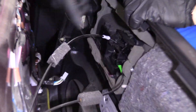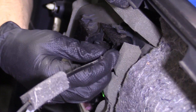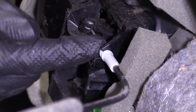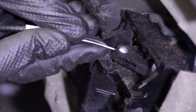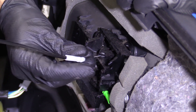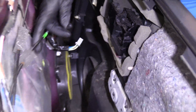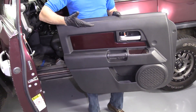Behind here we have our cables. This one's the door lock up along the top. All you do is take the white — you pry it away, then you lift right up through there. There's a little slot. It just comes through like that. Easy peasy. Next, I'm going to take this green one, do the same thing, remove those. Now we've removed our left front door panel. Easy peasy.